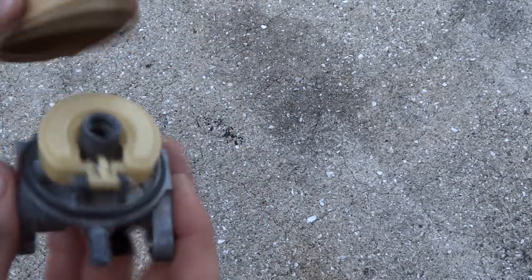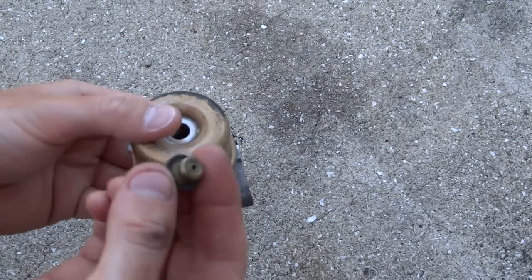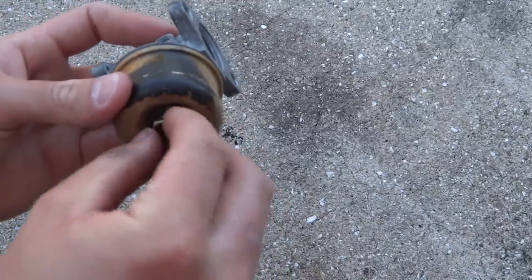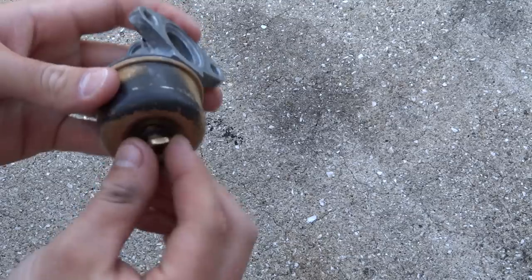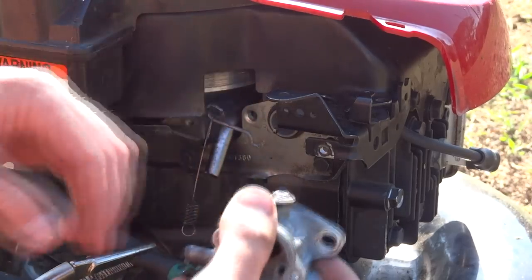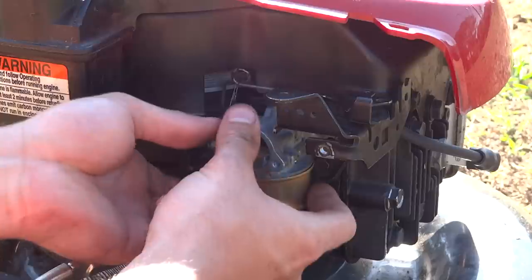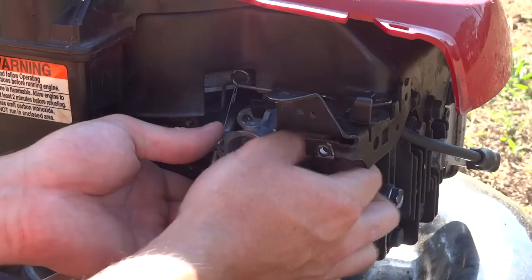You just take this and put it right like that, take your drain bolt and screw it back on. That's pretty much all there is to cleaning a carburetor. If people have really bad carbs, a lot of people just use ultrasonic jewelry cleaners and those tend to work very well. We just finished cleaning our carburetor and we're about to install it. Right before we install it, we want to put the throttle on first. You're going to turn the carb sideways, loop it in, and now we're able to put it back on. If you don't do that first, you're going to have to take the carb back off. It saves you a lot of time.